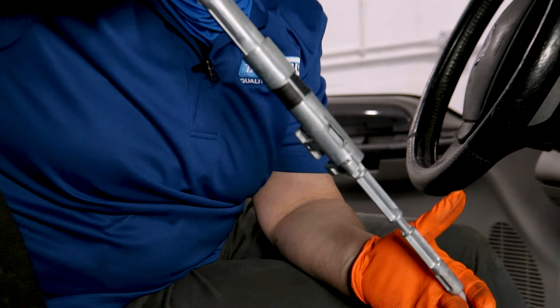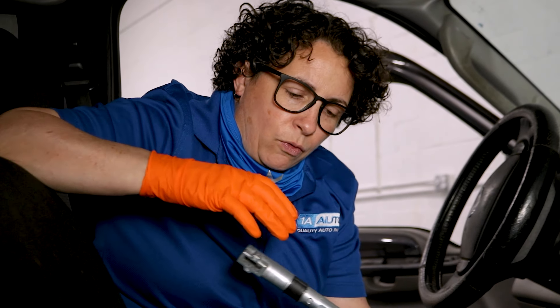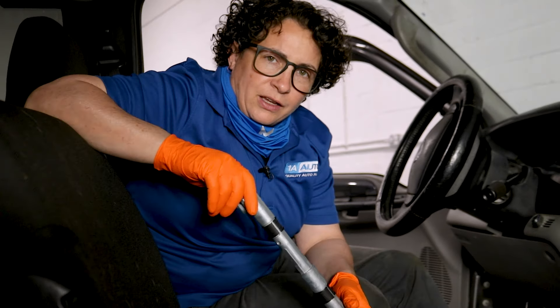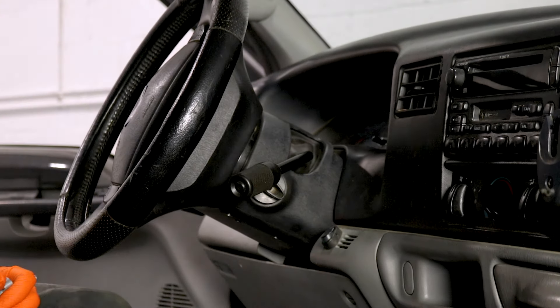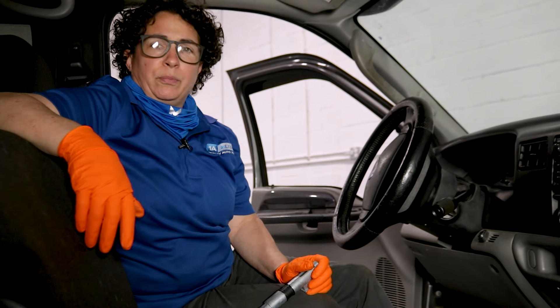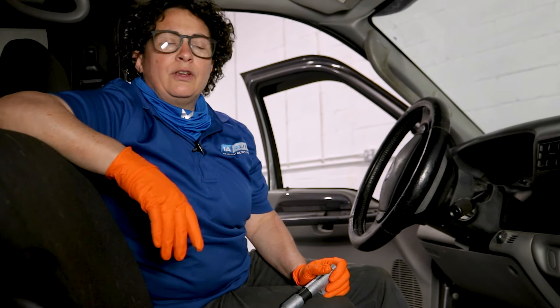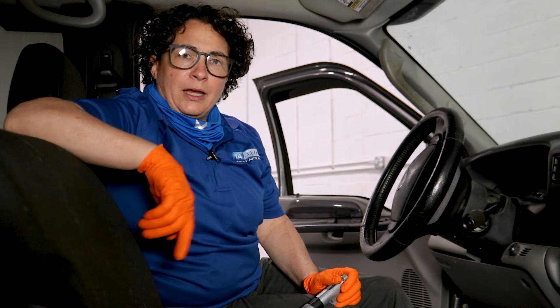Either the damper inside here — this plunger — snaps, the spring breaks so it kind of has a wobble to it but it still will shift fine. Or if this tube cracks, it's over. You get this lovely drop. You can't shift; it's stuck in whatever gear you're in, whether you're neutral, drive, reverse, or park. It's broken. You could get down and use the cable mechanically to shift it, but call me if you manage that, because I really want to meet you.